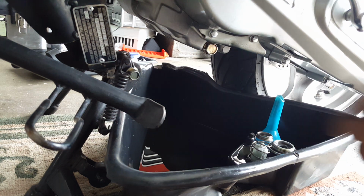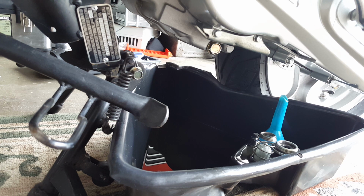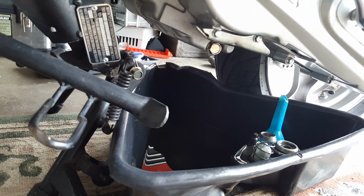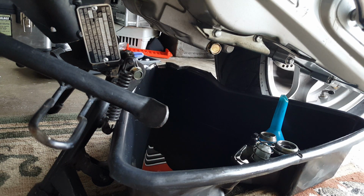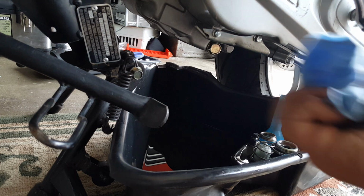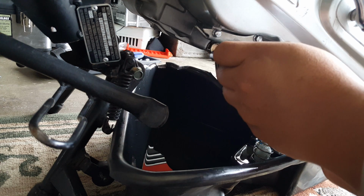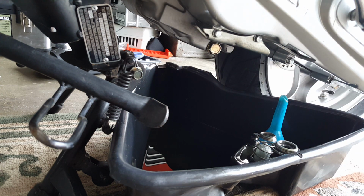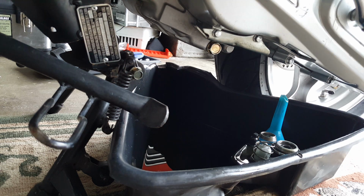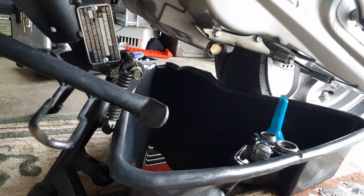Yeah, I don't have the socket on hand on this side, so let's go ahead and get that socket on there real quick. You can see me, I'm turning it with my hand, but it goes only so far. It's 17 millimeter back. And again, you want to give this a good tight, okay? Because if you don't, it's going to leak oil, and that's not something you want. Just a little drop or anything like that, you don't want that. So it's going to be righty-tighty now. Oh, gosh, I didn't even change the head socket. Let me go and get the 17 millimeter one. I had the 12 millimeter one still on there. That was brilliant. Awesome. All right, here we go.